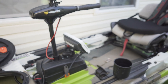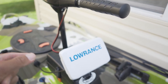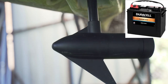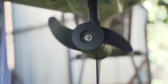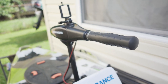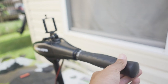So let's go ahead and show you the trolling motor more in-depth. I'm going to show you the bottom and how we lift it up and out of the water. If you guys can find a bigger trolling motor with higher thrust than this, let me know what fits and I'm going to absolutely upgrade. So it has 5 speeds. I recommend a 75 amp hour battery or higher if you want to use speed 5 — it goes 3 miles per hour at 5. On 4, it's about 2.5 miles per hour. 3 is at 2 miles per hour, all the way down. 1 is at a really good slow — half to a mile per hour. It really does good at one spot locking on a river. Because if you're going upstream fishing upstream and you put it on 1, you pretty much spot lock on that spot. It's really nice.